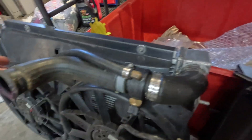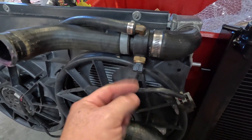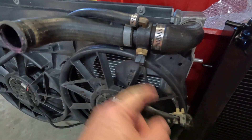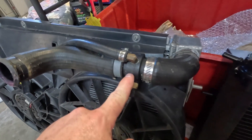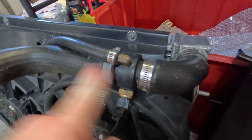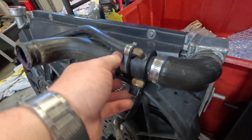With this top hose, that's how we did the steam port from the cylinder heads. There was a little temp sensor for the Davis Craig fan controller, which was originally in there. Then I got rid of that and was just running off the temp sensor from the engine in the Haltech. Because we're going to put the steam ports on this one, the steam port is going to go in here instead. So we're going to have a solid radiator hose without this adapter. A lot of people do it that way - it works fine. Going back in here instead, hopefully it looks a bit neater with a solid hose.